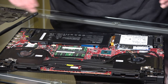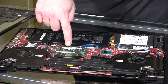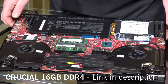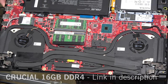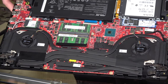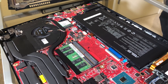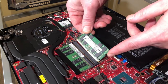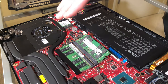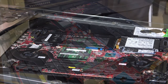Now we have full access to the inside. I've already added this additional memory module, so I'm going to go ahead and take it out and show you how that whole process goes. When you first get the laptop, it'll look like this as far as the memory goes. To install your DIMM, all you do is stick it in here and it's going to sit at an angle, and then all you have to do is press it down.